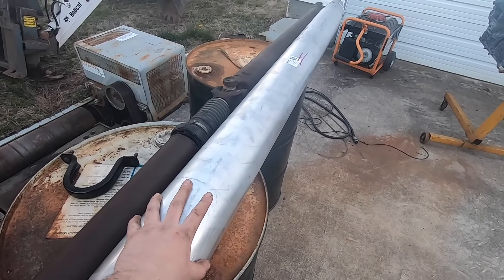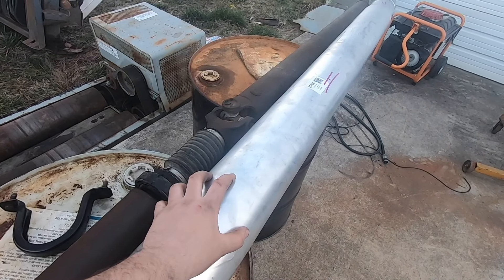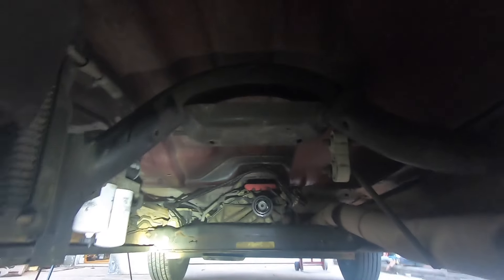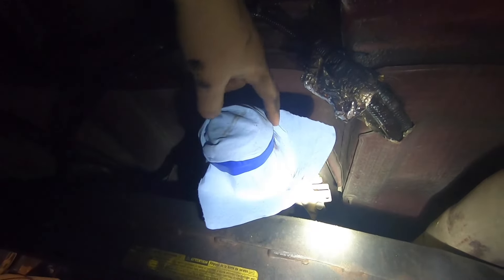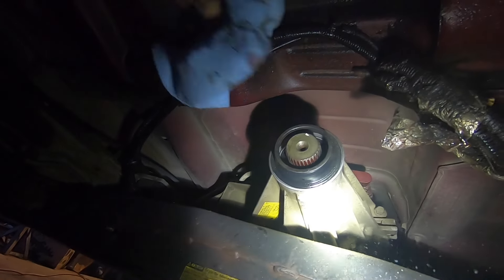There is one change we need to make. The bracket that this used to mount to is going to be in the way of this monster shaft, so we need to cut that off the frame before we install — get rid of this secondary bracket so the drive shaft can travel up into the top of the drive shaft support hoop. A little time with the flap wheel and cut-off wheel and the frame looks like it was never supposed to have it. Don't be a dummy and cut your fuel cooler line — it's right there. Tape it up out of the way. Also wrap a rag and painter's tape around the end of your transfer case to keep it from filling with shavings while you're grinding.